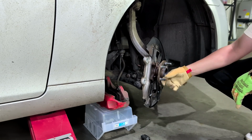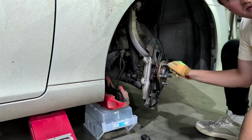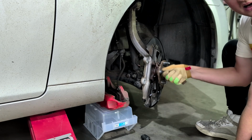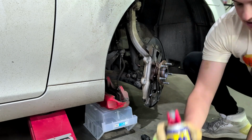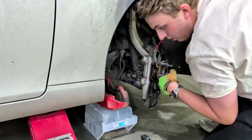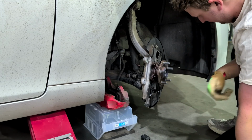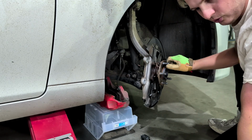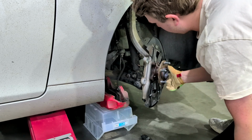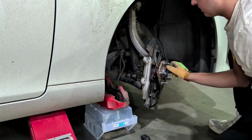Yeah. Like, you can hear... Oh, that sound. There you go. That's the sound I can hear when I drive, that little... It's the bearing inside has dried up and failed. Yeah. Just out of curiosity, temporary fix, this could have saved me a few $100. Nah, didn't do anything. You'd need to repack it with grease, but even then... Yeah, that sound. That's what's making the sound when I drive. And then the thud. Well, the thud will be when it's loaded up. Yeah, which will be hard to replicate.